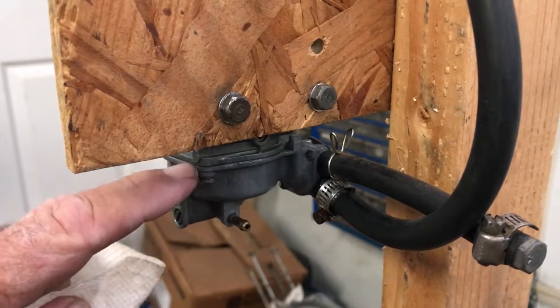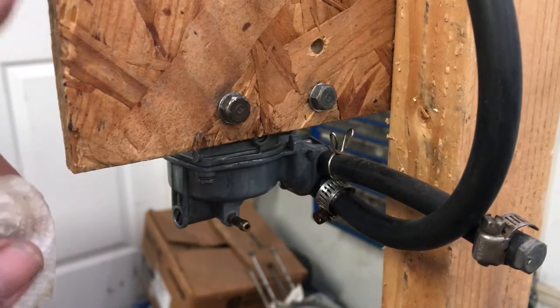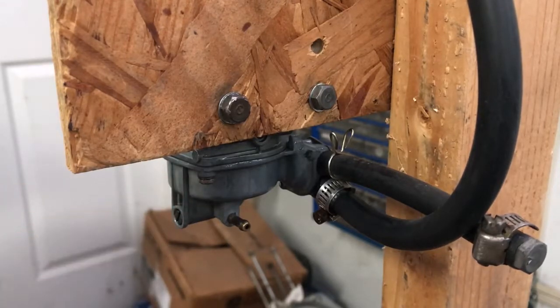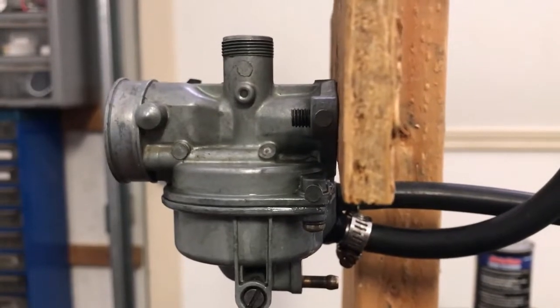This is leaking so I'll need to get a new gasket right here — they're available new, but they're a bugger to put on to get them down into that little crack. I also need a new valve, and you can get aftermarket Chinese valves. Anyway, this was a success — it's easier to diagnose the problem here than standing on my head or crawling on my elbows and knees when the cover is mounted on the ATC. It's easier to fix sitting at the workbench, take it off, fix it, put it back on, and test it quickly. The fuel tank has gasoline in it so you could ride it around like this, but it's not really quite right.